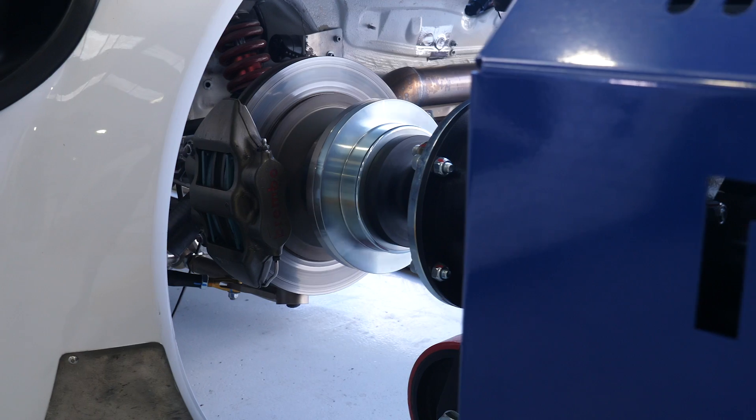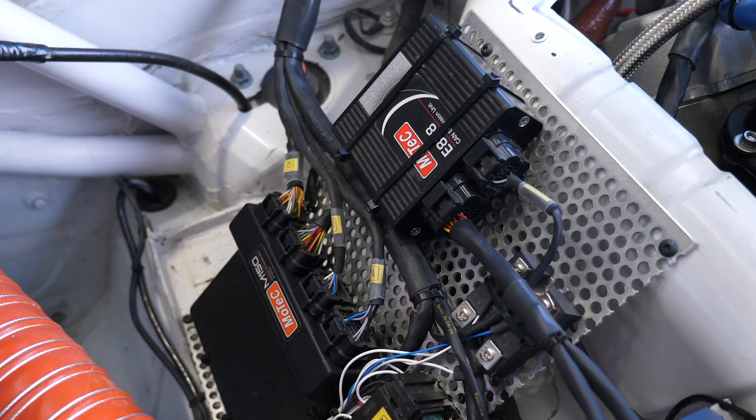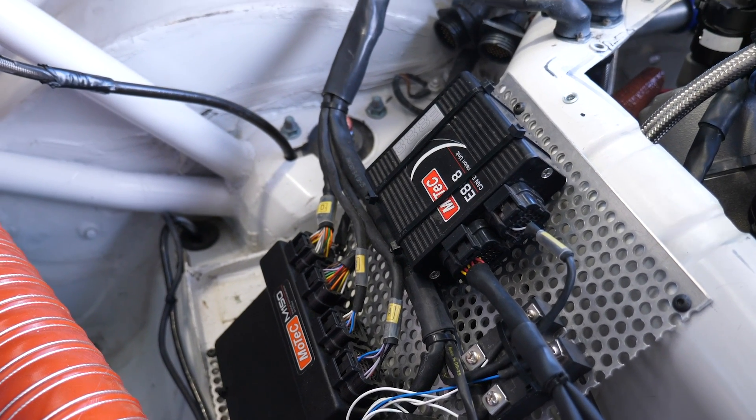This is helpful because it means we're not putting a lot of stress and heat into the engine, which becomes particularly important as we get into the higher RPM ranges. With the Motec M150 we are also using closed loop air fuel ratio control, which helps make sure that the engine is running the correct air fuel ratio and we're not going to be potentially running the engine dangerously rich or lean as we move into untuned areas. What the ECU is going to do is monitor the air fuel ratio and apply a closed loop trim to get it back to where it should be. However this doesn't mean our fuel tuning is correct, and ideally we don't want to see our closed loop trim applying much more than about plus or minus 2%. This is where the quick lambda key comes in — pressing it will apply the current closed loop trim into the VE or fuel table, fixing that error in our air fuel ratio.